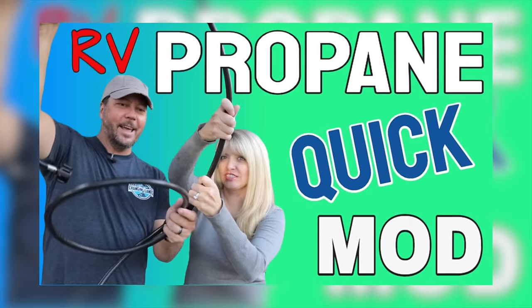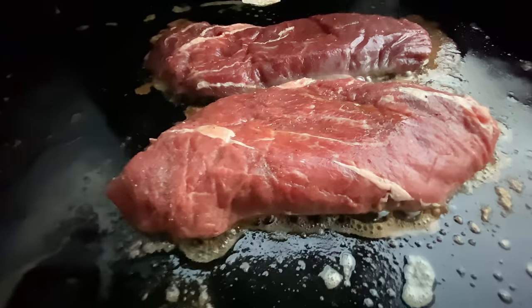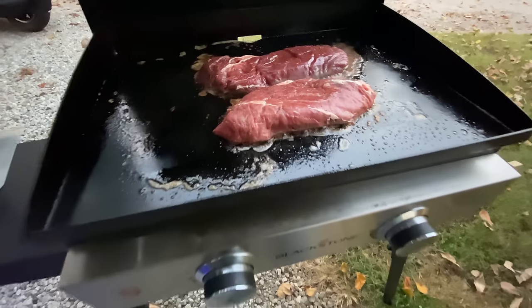Our last tip is really an update to a tip. We did a video probably a couple of years ago now where we had a quick propane setup. We wanted to be able to connect our Blackstone easily to our propane system with minimal effort and be able to set up and use it. At the time, we had purchased a Y connector and a regulator and a hose to connect to the Blackstone. And after a while, we noticed that the regulator that we had just didn't work very well. It wasn't letting enough gas through to the Blackstone.